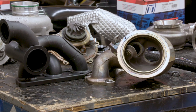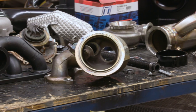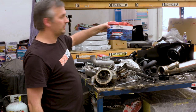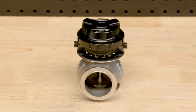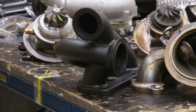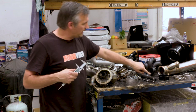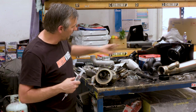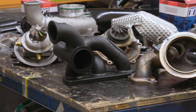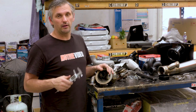Obviously the Yaris has an internal wastegate, and we are talking the overall opening. We're talking 27, 28 millimetres for the opening versus our wastegate over here, which is a 45 millimetre wastegate. And the opening for the gate, 38 millimetres for the actual physical opening of the exhaust manifold runner. So 38 mil worth of runner size, and then a 45 mil gate versus 27 millimetres. So we've got 11 millimetres as a minimum more flow when it comes to the diameter of the wastegate opening.